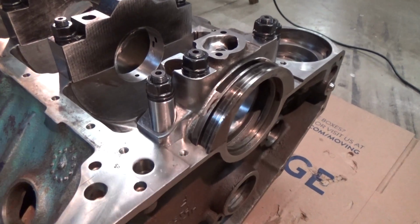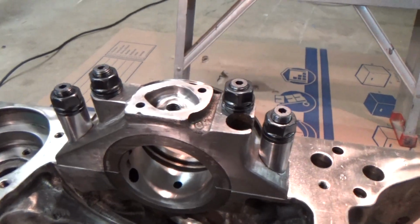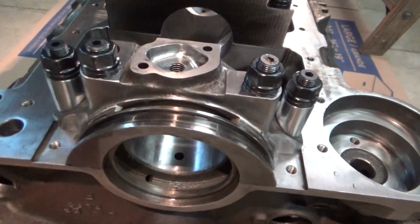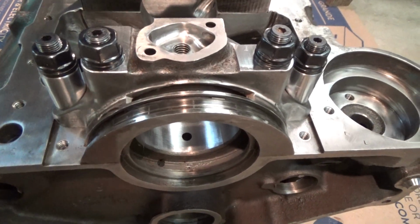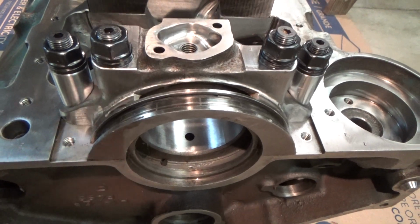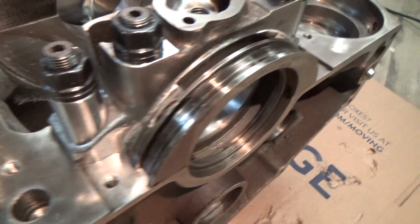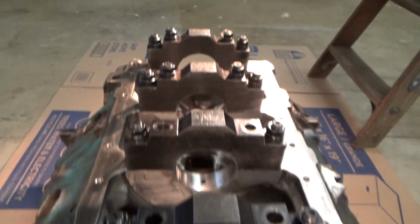And some other things that we can do with those old die grinders and sand rolls is we can, I don't know, I call it fluffing stuff. So like this rear cap here, it was a 2-bolt main, that actually 2-bolt main rear cap that came on that motorhome, and I converted it into a 4-bolt main, then put the other billet caps on it.